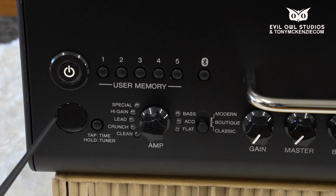Now, there is another feature relating onto this thing, and it's called an extended stereo setting. If you hold the switch down for more than 3 seconds, it switches the extended stereo function on or off. Be aware it only produces a wider field from the AUX jack, the USB jack, and Bluetooth, as well as the reverb effect itself. The extended stereo setting is stored however you've left it when you turn it off. You've got an amp knob here. It says on, look.